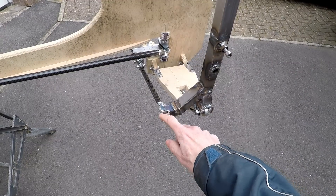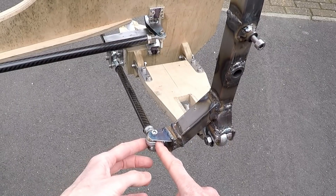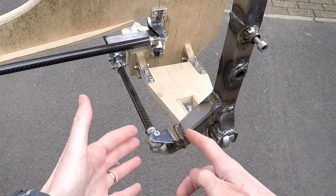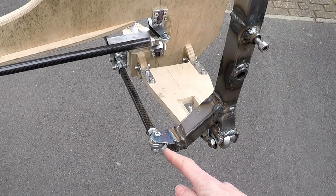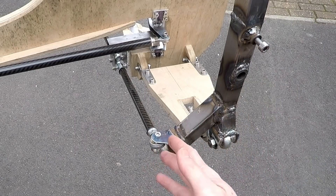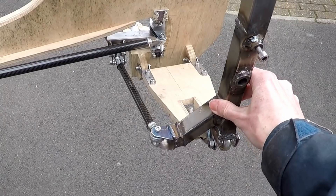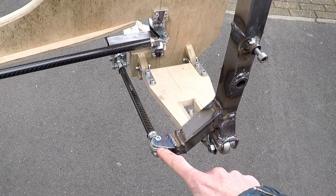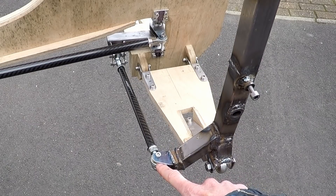Taking you down to the steering arms here, I've chosen to fit the outer end of the steering rod end in the horizontal position. This is mainly just to make the design easier. I've actually got enough articulation in the rod ends with the misalignment spacers to have fitted those either way round and not limit either the steering or the tilting angle. However, this is the rod end here that does actually limit the tilt to something like 30 degrees — I'll measure that in a minute.